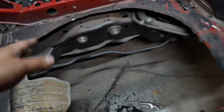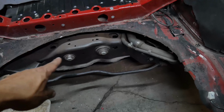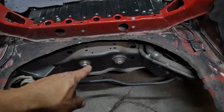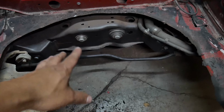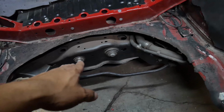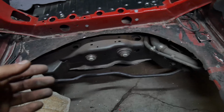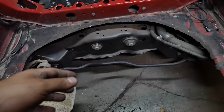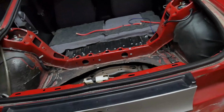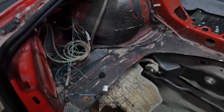One of the reasons a lot of people do this, honestly, is so you can get access to your rear differential, those two bolts. If you still have that spare tire compartment on, you technically have to drop your rear subframe to replace a rear differential. But this way, now I have a lot of space. It's easier to take it apart and all that. Probably in the next video, I'll show you guys the final product and where I'm at with the car.